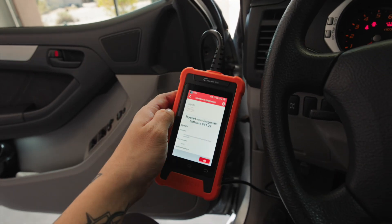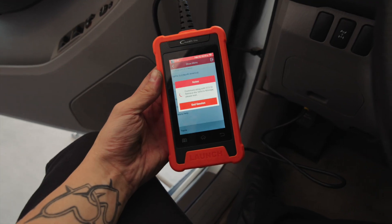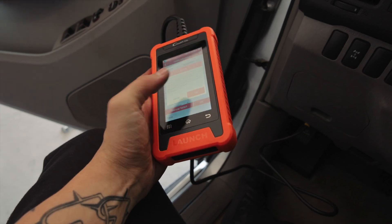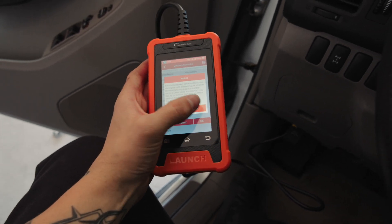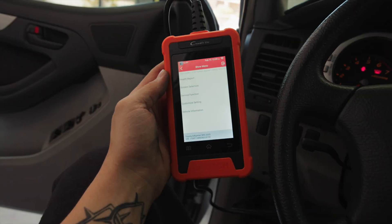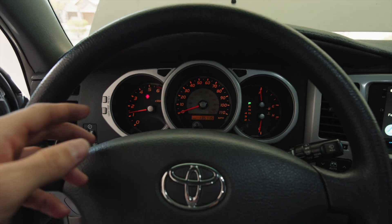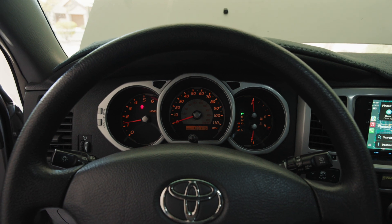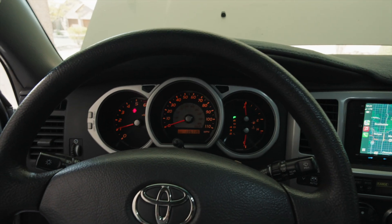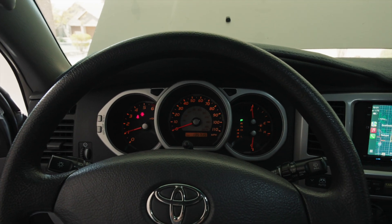If you don't have one of these OBD tools they are very handy - this is what gave me peace of mind. I was in St. George with my family and used this to read the code, did some research online, and figured out it was just from the weather being cold and the system was stuck closed. Codes are cleared - if they don't come on after two cold starts then you've installed it correctly. Big shout out to Hewitt Technology - clear those codes, bypass your secondary air injection system, and save yourself about three thousand dollars.